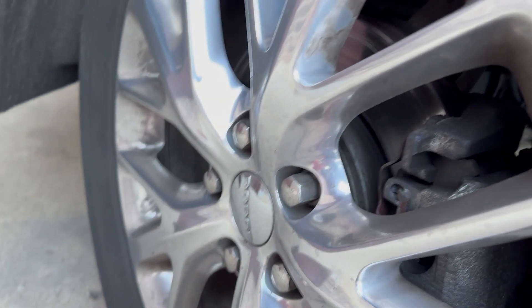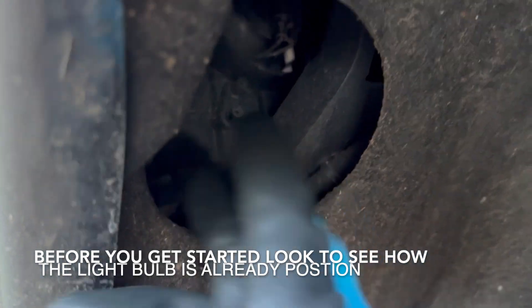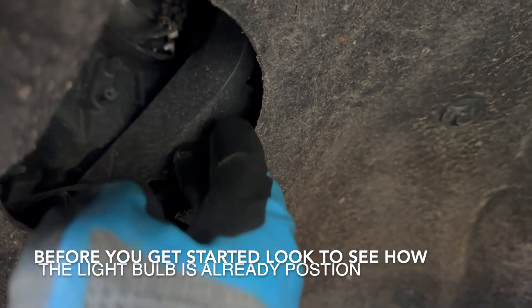For the 2014 to 2016, you can change the headlights right here. I'm gonna show you on the other side — see, right here they got a cap. All you gotta do is turn your wheel to the right so you can get your hand in there. Turn the wheel all the way to the right and boom, now you've got access.